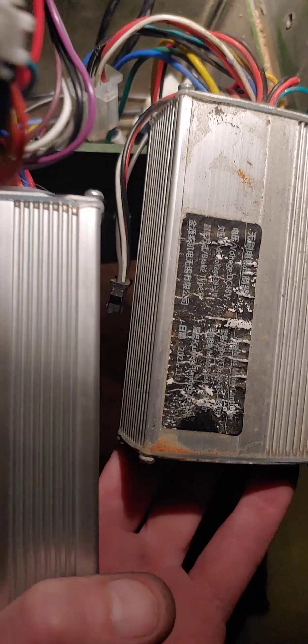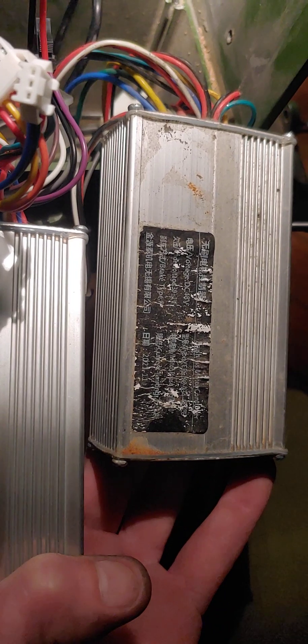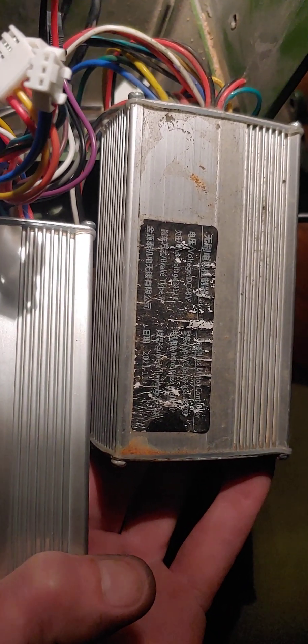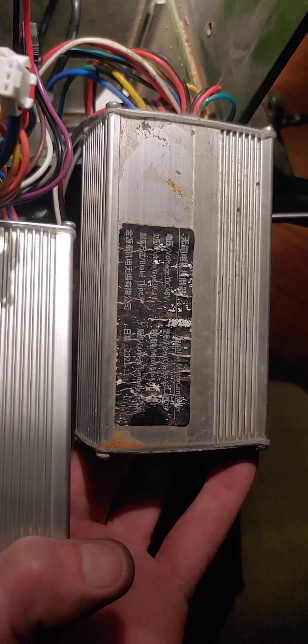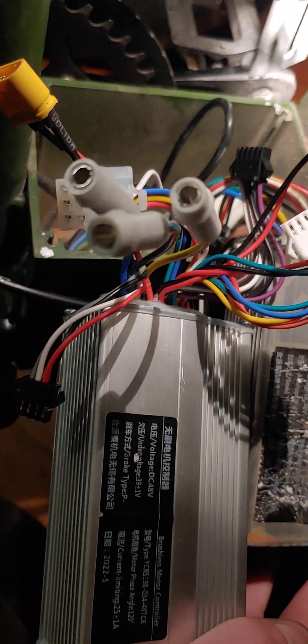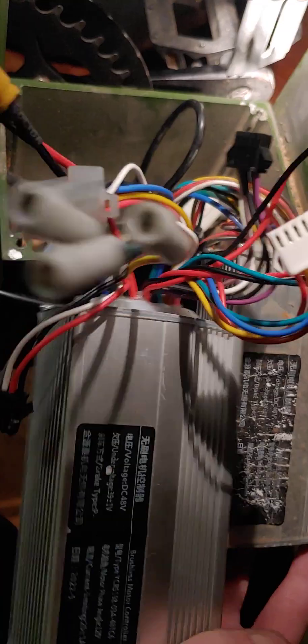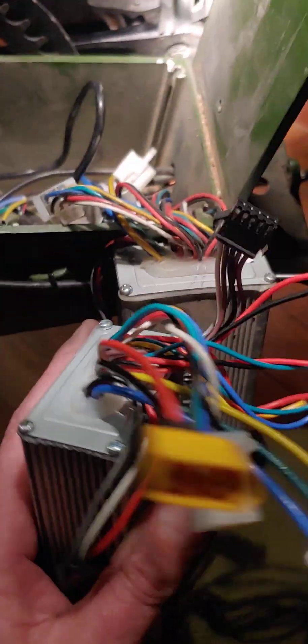The upgraded display is what is muting your acceleration. Now if you have the 250 motor because you've got a replacement bike, you might want to swap out the rear tire, and that's what I'm doing too. I'm going to swap out the controller, the rear tire, and the display on the old bike — it's pretty much a straightforward process. There are a couple of wires in here that don't get used, so I just fold them back when I'm taking out the controller and notice they're not connected to anything. I fold that back so I know when I put everything back together that it's not going to be used.